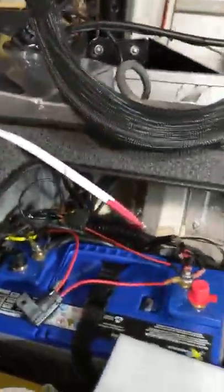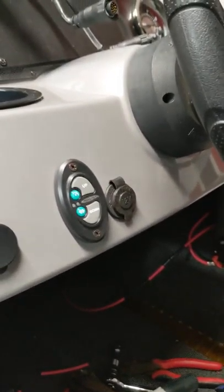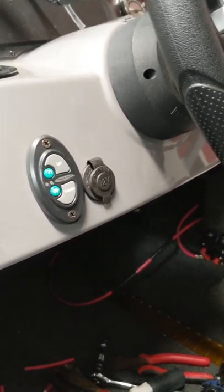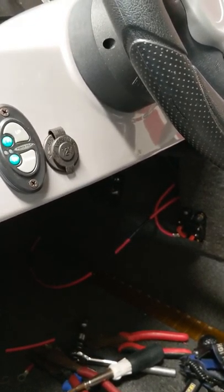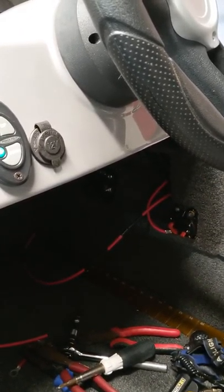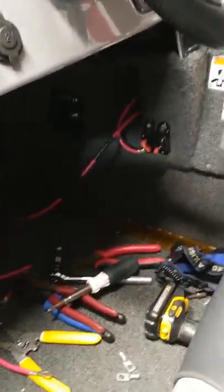They say that's supposed to fix the problem, so we'll see. After I get that in and hooked up, I'll hook these up. But the negative I am actually going to take straight to the negative on the Solex. They came with like 16 feet of 18-gauge wire coming off the back of my Solex, and they just bundled it up in the back and tied it up. I think you get voltage drop on this stuff, so I'm going to shorten that as much as I can before I hook it to the fuse block and the negative. So we'll see — I'll let you know.